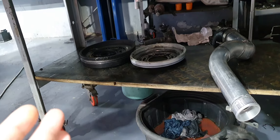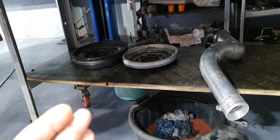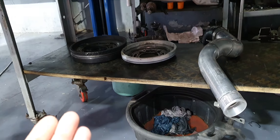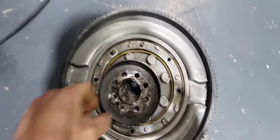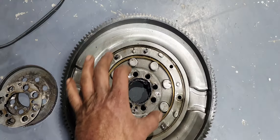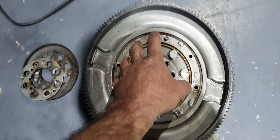My plan from the first place was that when I remove the dual-mass flywheel, we're going to be nice and safe and I'll be able to insert the new dual-mass flywheel. File it a little bit if there is any high spot on the crankshaft and put it in. That's why I was willing to measure it with a micrometer to see that it's true, that it's round and not compromised. The inner is to align properly the dual-mass flywheel, to not have an offset. It comes usually tight — a tight fit, not loose. It's important because it's also for the forces.